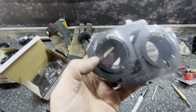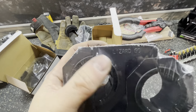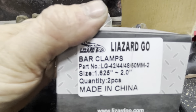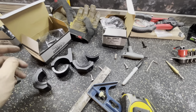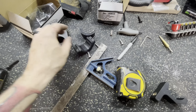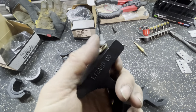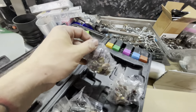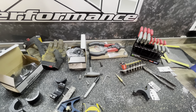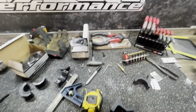You get two bar clamps with a hole through them and a rubber lining to clamp the bar, and you get different size bushings based on what size the listing says they fit. This one fits about an inch and five-eighths to a two-inch bar. I went through and picked out the appropriate one — five-eighths, which is the 1.625 inch. Then I drilled out the ends where the circle's at to a seven-sixteenth. Seven-sixteenths allows me to put an M8 nutsert in here. I prefer metric — a lot of bolts I have from the collision industry and automotive bolts nowadays are metric, and I try to keep all my stuff metric because that's what my business is set up around.